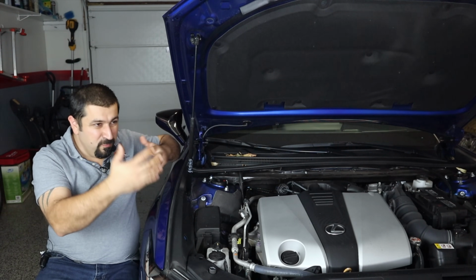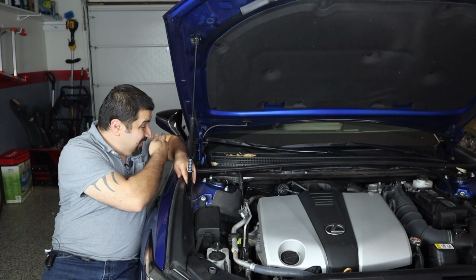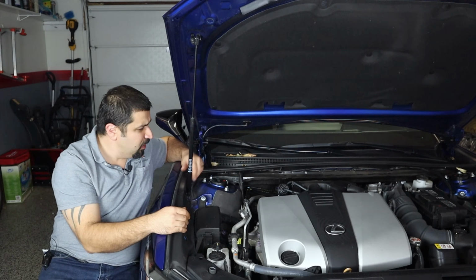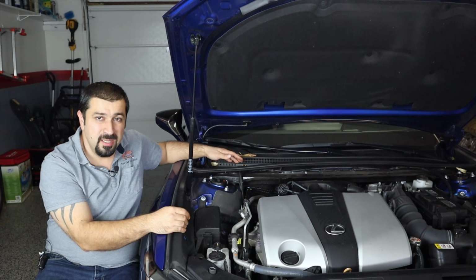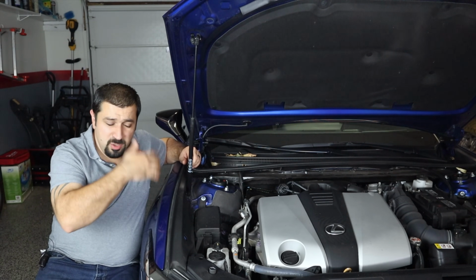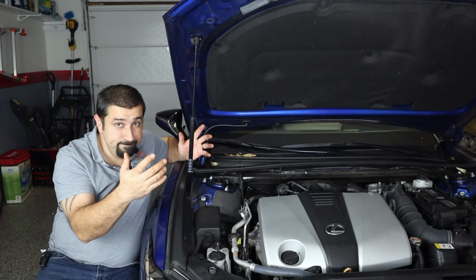You're wanting to prevent this. And the other mistake is, and this is shops, I see technicians where I work, they see those leaves and they're trying to be nice to the customer. They take compressed air and they blow it out, let it fall, and life's good. Well, actually, when you did that, you pushed some of it inside. Do that year after year after year, and the AC drain is clogged. And you're going to say, well, this could take 5-10 years, I'm not worried. Well, it only needs to happen once for your car to be destroyed by water inside.